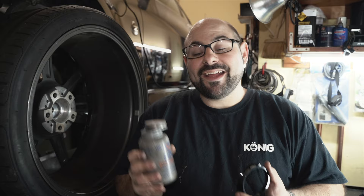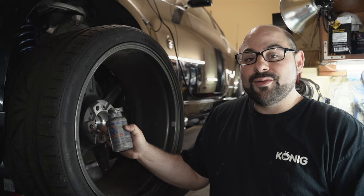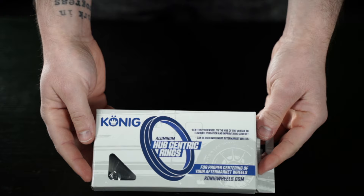Whenever you install an aluminum hub ring, you want to use a little bit of anti-seize. Anti-seize is basically just a light coating on both sides of the hub ring to make sure it doesn't build up with corrosion or cause sticking issues down the road. Whenever you put two types of metals together, you run the risk of corrosion buildup, and getting a wheel off the car with aluminum hub rings and an aluminum wheel can be extremely difficult — to the point where you're kicking and screaming trying to get the wheel off. A little bit of anti-seize goes a long way.